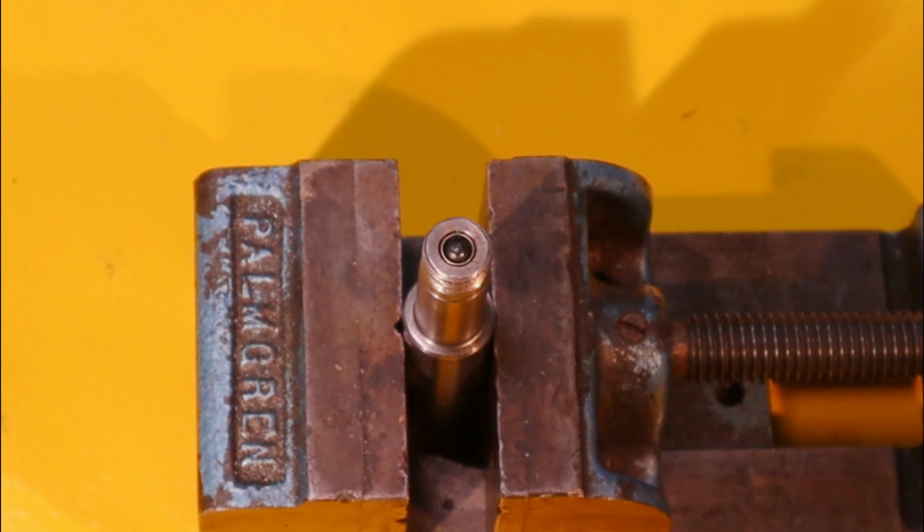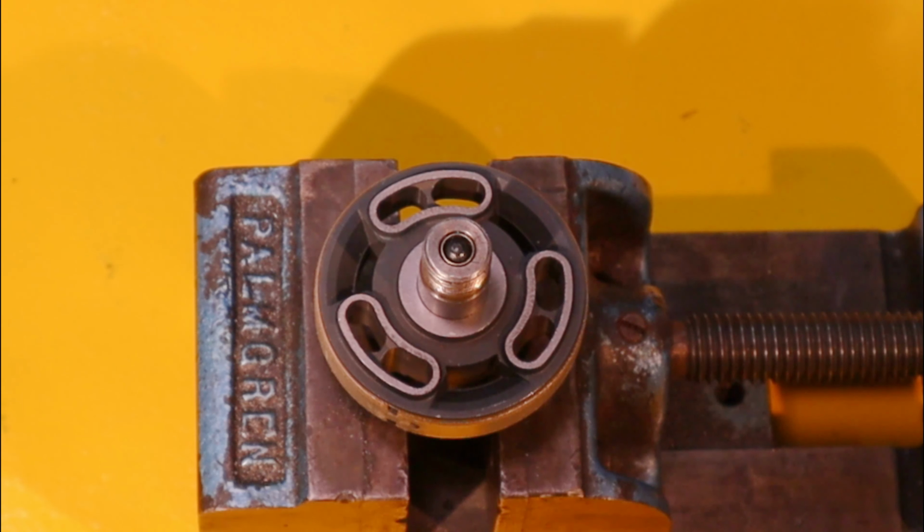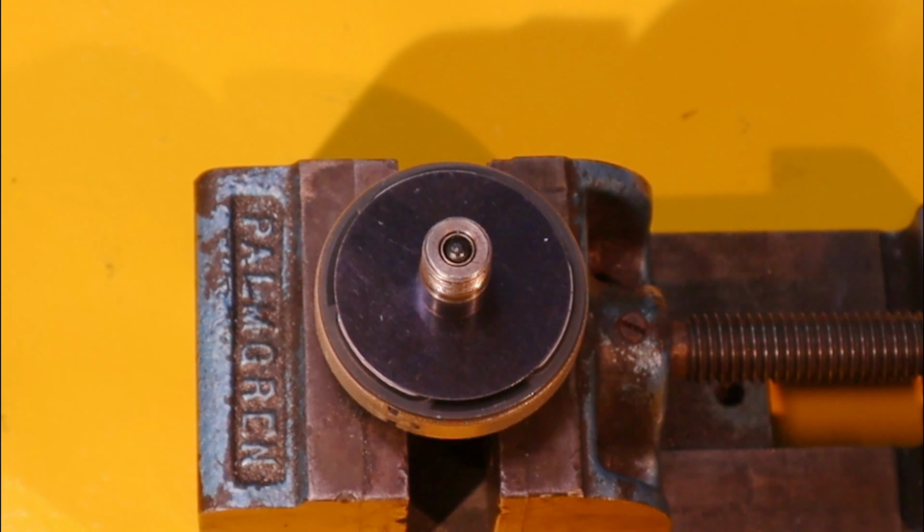So here's a 46 millimeter piston. Now this is only 2 millimeters bigger, yet Ohlins now uses a 40 millimeter sealing shim. You want those ports as far out as you can get them.